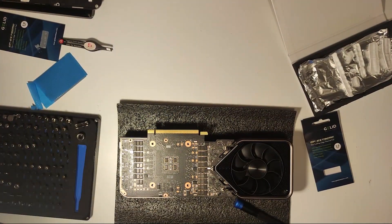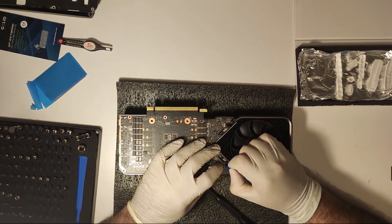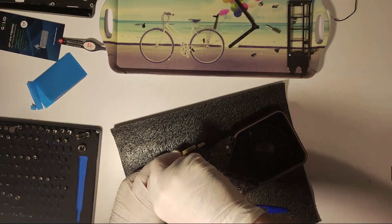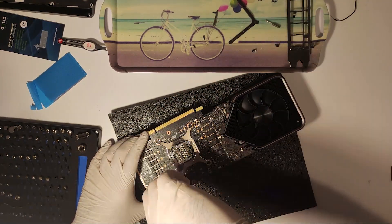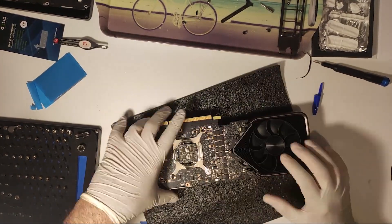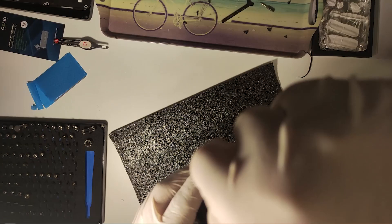Once all the cables are poking through, I suggest putting the leaf spring on before clamping them back in their receptacles, just in case you need to slightly reposition the PCB. Refastening the leaf spring is actually a breeze — there is no way to technically over-tighten it as the fasteners have springs that prevent you from cracking the die underneath. Do the exact same procedure in reverse as when you took it off, working in an X pattern and not progressing any one corner too fast. If you lose or strip one of the screws, do not attempt to replace it with another similar one as you risk damaging the silicon underneath — just order a water block. Once the leaf spring is tight, reinsert the cables and close the gates, making sure both ribbon cable gates are up and the metal cage is open before inserting any of the three cables.